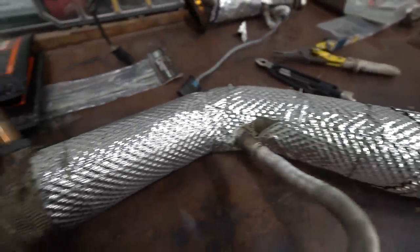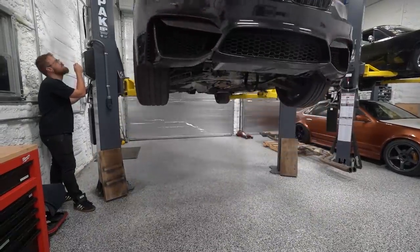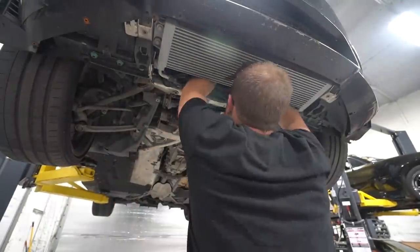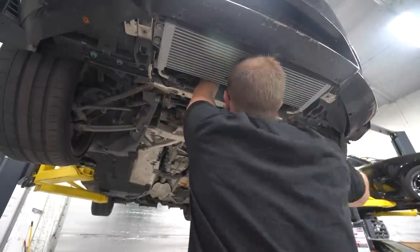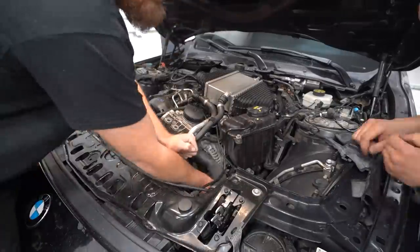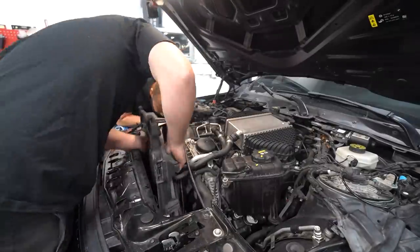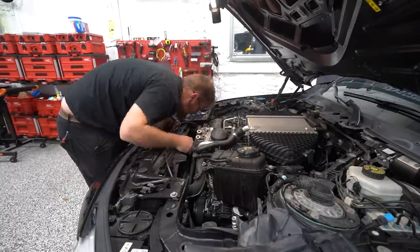These are definitely interesting plugs — very different than a standard plug, which is why we needed this special 14mm 12-point swivel socket. All in all a pretty easy process; we got them torqued down and went ahead and got our coil packs back in, which is actually more serviceable than most. What a surprise — not something you'd expect with a BMW. We're still waiting on a couple of parts to reassemble the top of the engine and get the intercooler back on, but we can at least get this front stuff done so it's one less thing to worry about as we're tearing into the rest of the car.